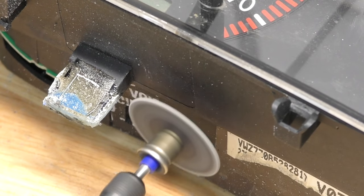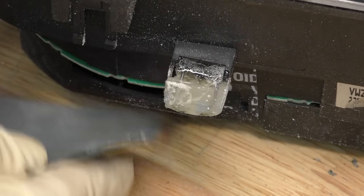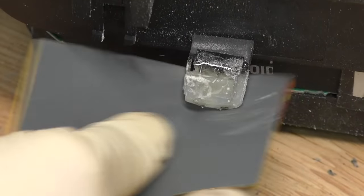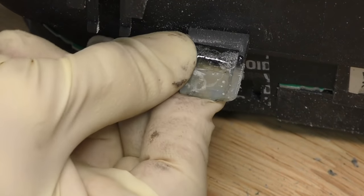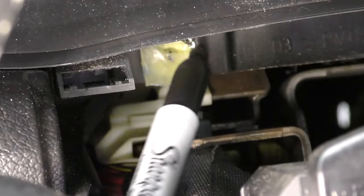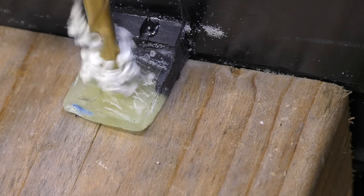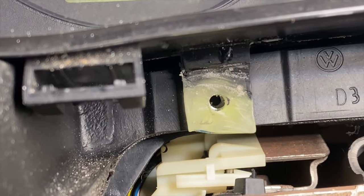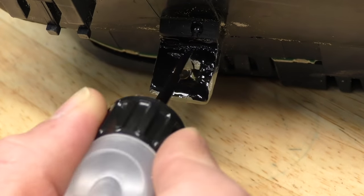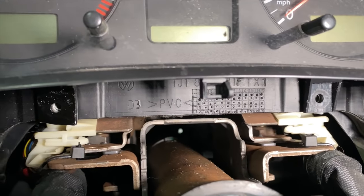This is going to give us a rough shape for our final product. It may not be a bad idea if you're working with electronics to tape everything off so you don't get dust inside your component. Once you get the shape pretty much where you want it, you can spend more time sanding it with increasingly higher grit sandpaper to make it look super nice. Next, we're going to loosely install the instrument cluster so we can put a mark on it where we need to drill a hole for our screw. We'll find an appropriate size drill bit and carefully drill out that screw hole. Once that's done, you can sand it a little more if you want, do another test fit, and make sure everything lines up. Now if you want to go that extra step or you're repairing a piece that's going to be visible, it might be worth painting over the epoxy — this basic exterior automotive touch-up paint covers it up really, really well.